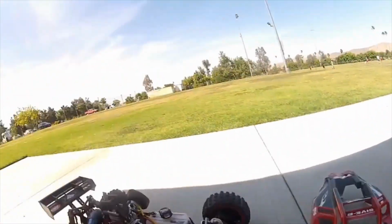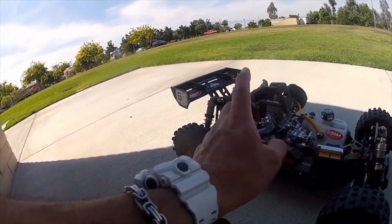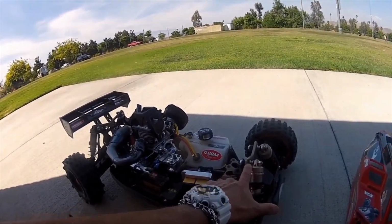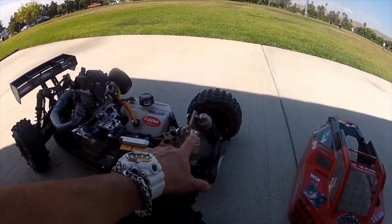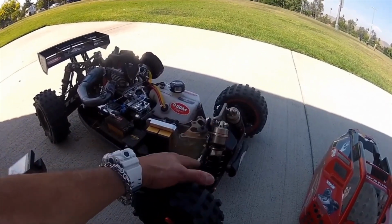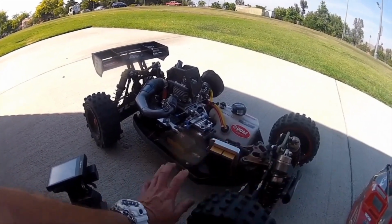She's so far intact. We tumbled her around a little bit. We beat this thing up a little, so hopefully we didn't do any serious damage. By the way, I had a few people ask me, I highly recommend a couple things if you're going to build a 5B. Titanium turnbuckles. Change the turnbuckles and these shock stays, or shock mounts. These posts aren't steel like the stock ones. These are titanium. So I would change these to titanium all the way around. The turnbuckles are going to run you about $200, but you will save about a pound of weight. And in pit scale, especially on this thing, you will gain that in performance. Okay, that's just a fact.